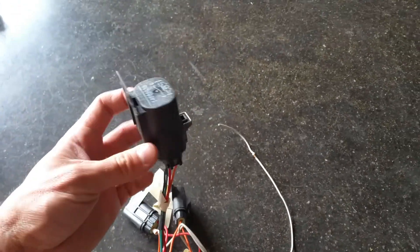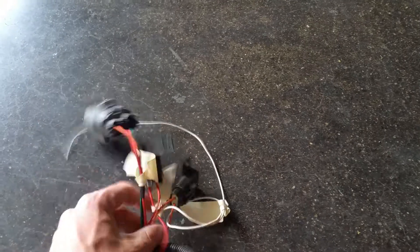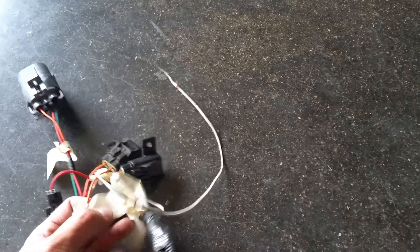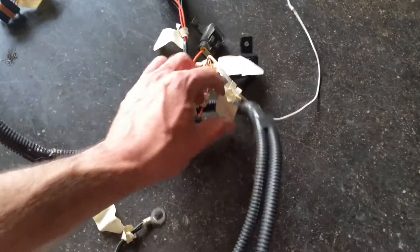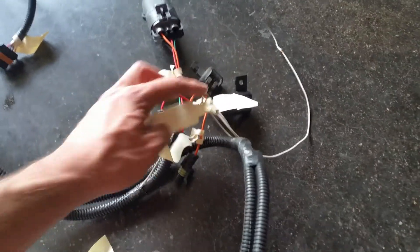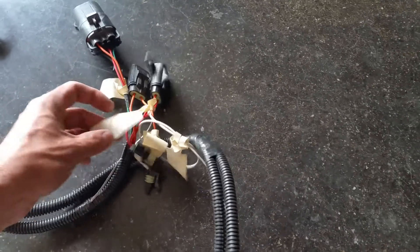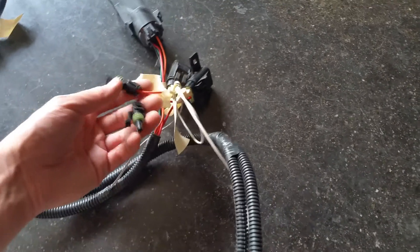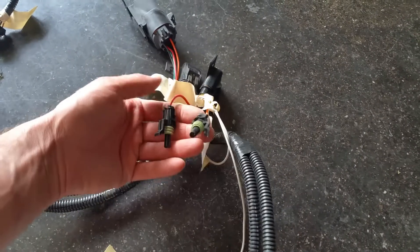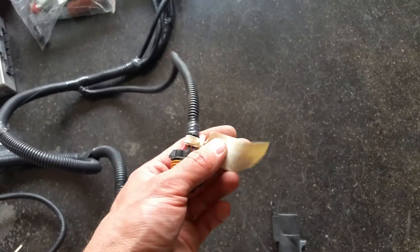This is your fuel pump circuit. This big guy is your fuel pump relay and it's got some fuses incorporated in there. This is your direct-to-battery power feed, and this one is your tach out — that white wire just goes to a tachometer. And then there's power to the fuel pump. These two right here are just your power to the pump and then your straight power to battery.